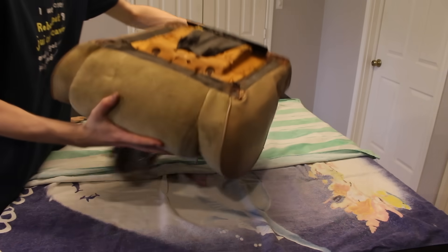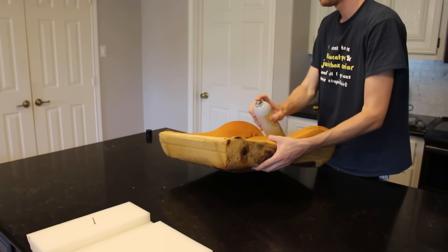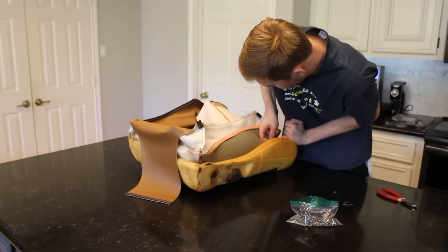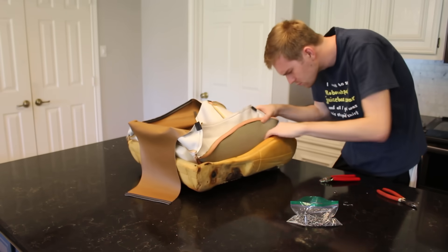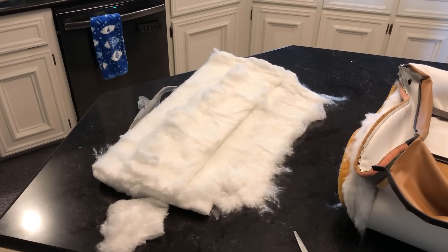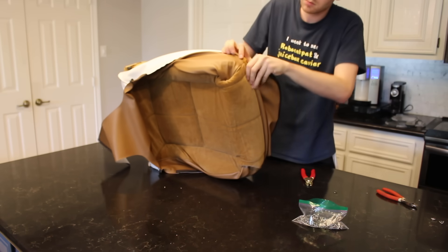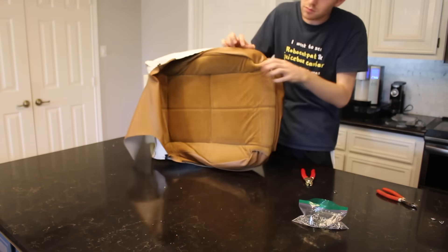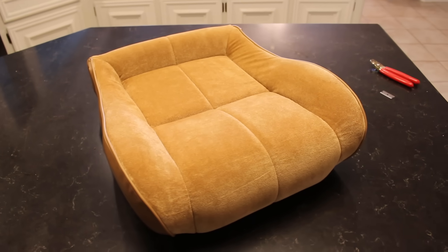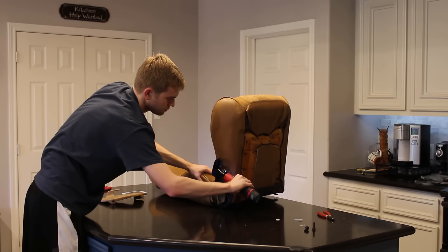The bottom is essentially the same process as the top — pulling off the original and exposing the listing wires in the foam. This time, there's foam supplied in the kit for the lower cushions, secured with spray adhesive, then more hog ringing everything down. The side listing rods were slid into the loops, secured with hog rings in the front. Just because the side bolsters get a lot of wear, there's cotton supplied in the kit as an extra layer of padding. With that in place, the sides were slid around the bolsters, pulled snugly and evenly, and hog ringed to the base. We're left with a beautiful piece of art. The only thing left is to attach the top half to the bottom half — cut holes for the bolts and bolt everything together.